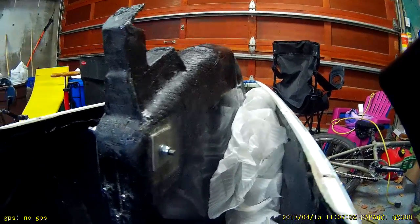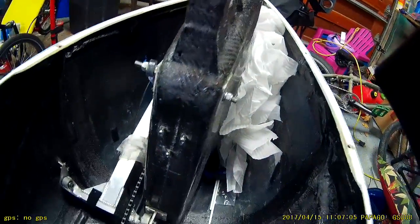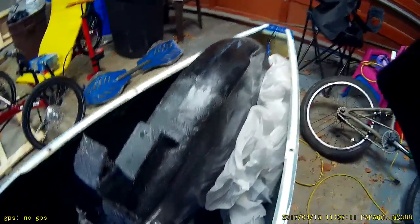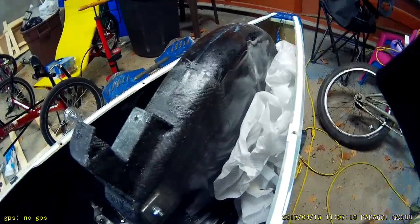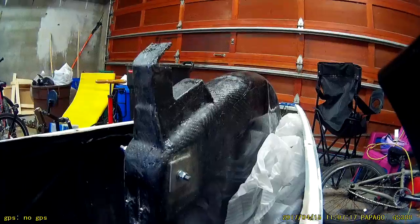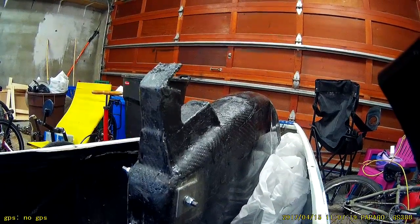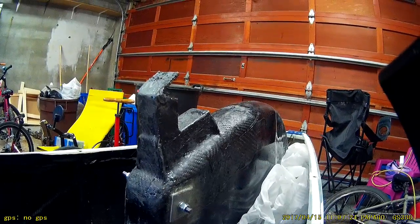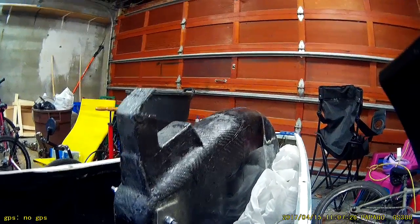On the inside of the tunnel I used aluminum plates with fiberglass, and then the same on the outside. This now holds the shock. I added some carbon fiber to the top of the tunnel to strengthen it and make sure it would hold the stresses. As you can see, I created a gusseted box section brace to attach the top of the velomobile.